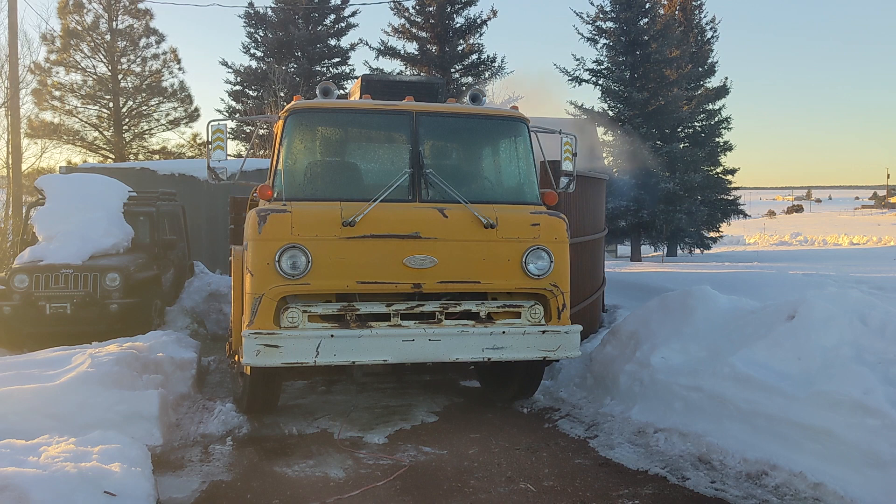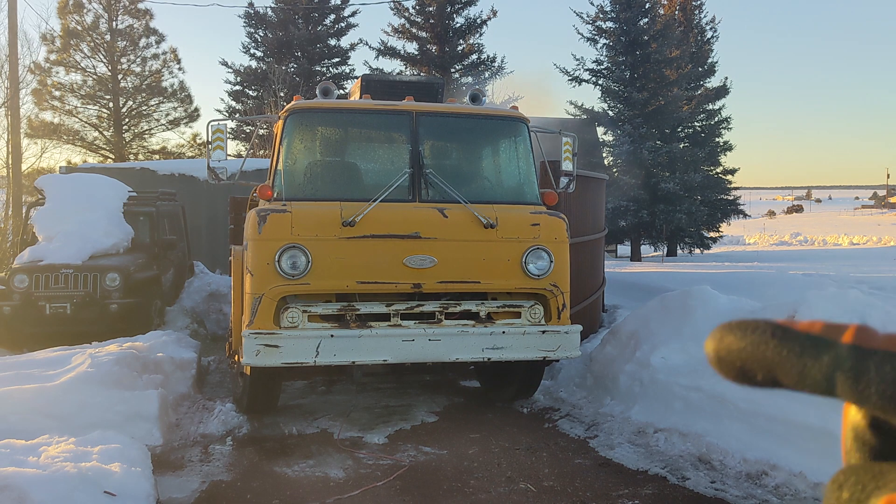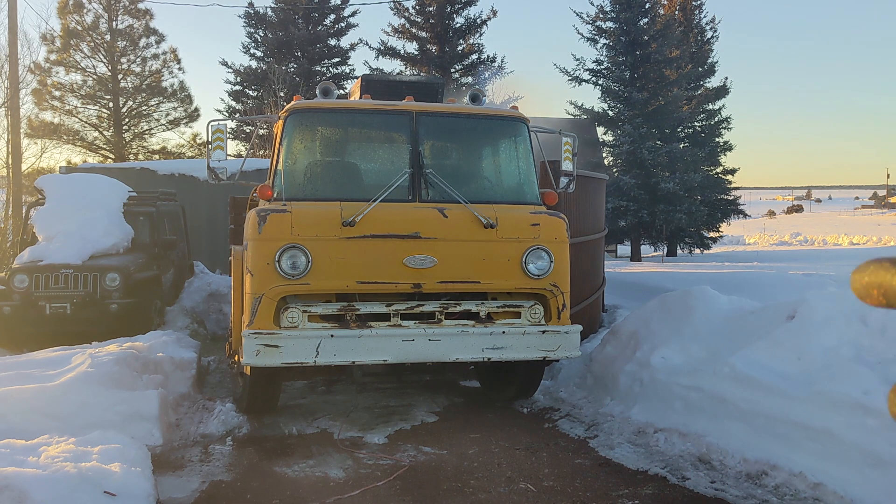It was under $100. I did a video on how to install one — they're pretty easy. They make some that you can even slap onto the oil pan; it's a little pad, an oil pan heater, and those help too. This particular one is the kind that's in the water jacket — I took out a plug, put this in there, it took me 30 minutes or so. Anyway, there you go — block heaters for the win.